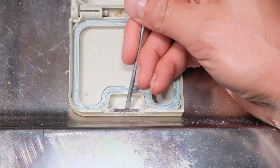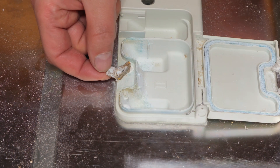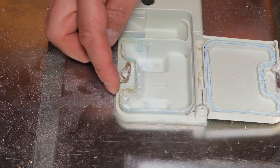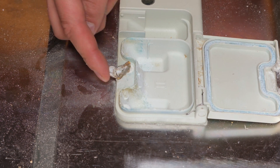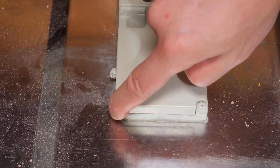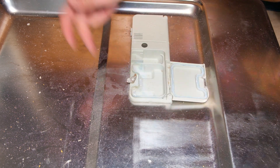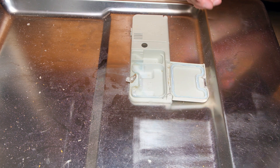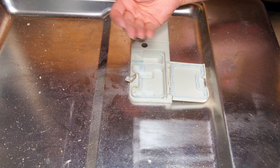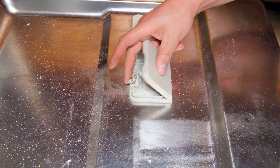You can see the metal with plastic welding on the sides holding it in place — this is really strong. To break this would probably break the whole front door. Using this metal I can hook it nicely — see how grippy it is. This piece was completely non-existent, having broken off a month ago. Now the lever is back, and when I close it, it pushes the lever in because of the beveling and holds very firmly. The latch is working perfectly — very rough but very functional. This will bring new life into this dishwasher. I'm not going to paint it because the water and heat would remove any paint anyway. Thanks for watching, cheers.